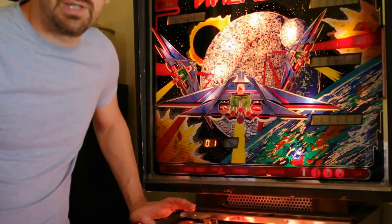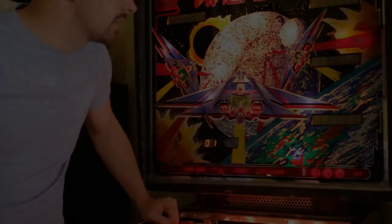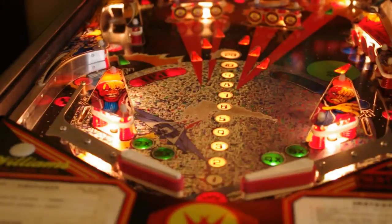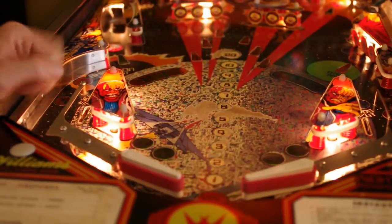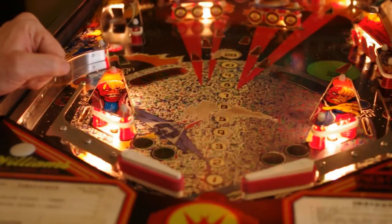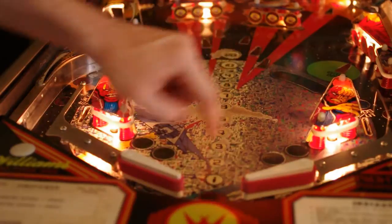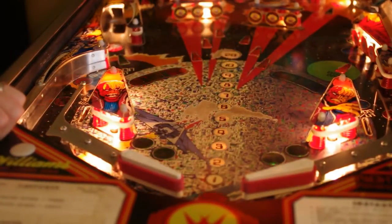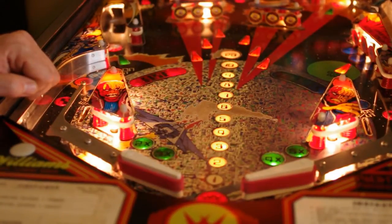This is a lot more powerful in the System 11, but for System 3 to 7 this is really all you've got for the lamp display test. This is showing the actual playfield as opposed to the back glass — just blinking all the lamps in sequence, but it does make it easy to spot burnt out bulbs. I did not notice before that I've actually got a burnt out bulb here in the power insert, and the number one in my bonus tree there is also burnt out. I'll take care of those a little while later, but it helps to show you the faults on these.